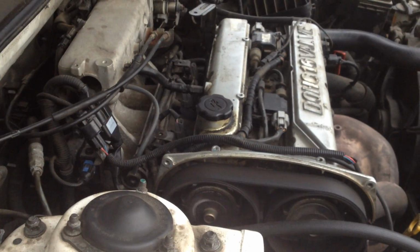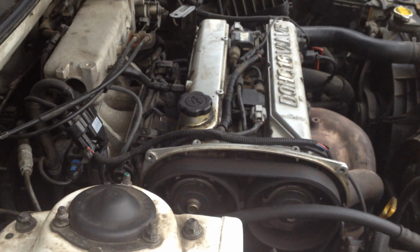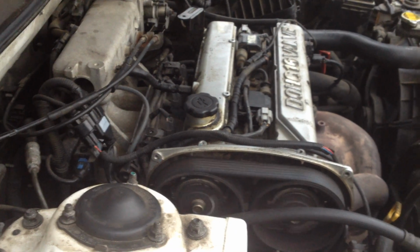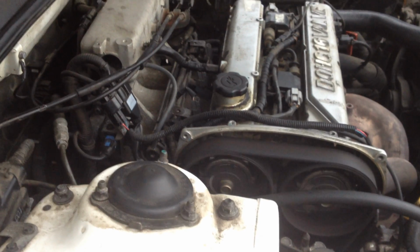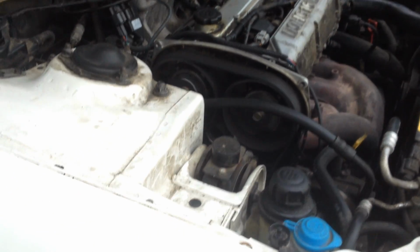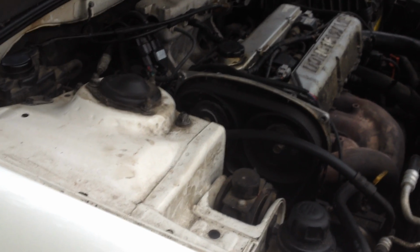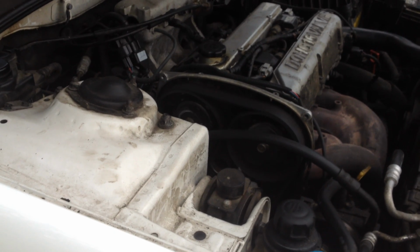so it is cold, but even when we warm it up and let it run at 1100 and get to proper heating temperature, it still does the wrong thing. Still does not start right away. It has the issues of starting. Have changed fuel pump, crankshaft position sensor, camshaft position sensor, coil packs, and have done the timing all again.